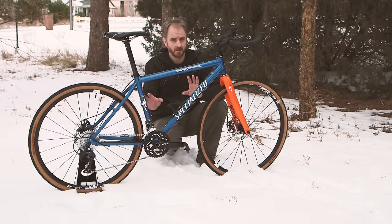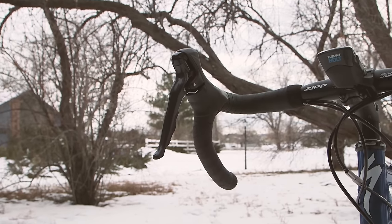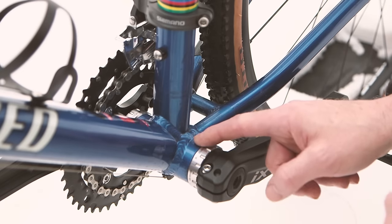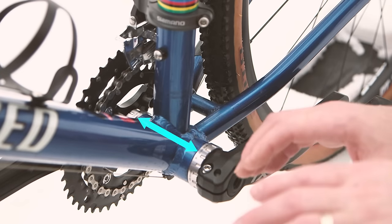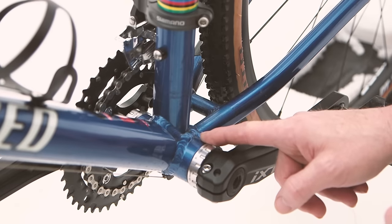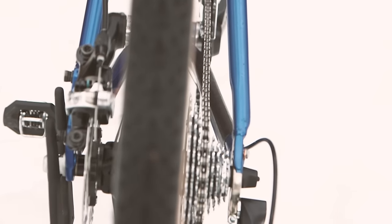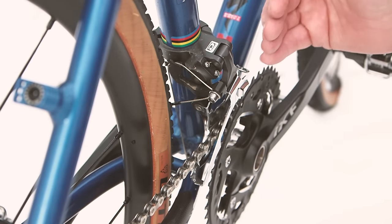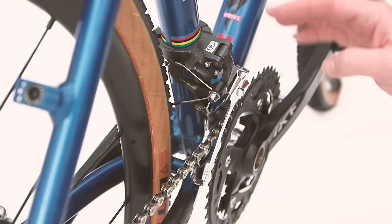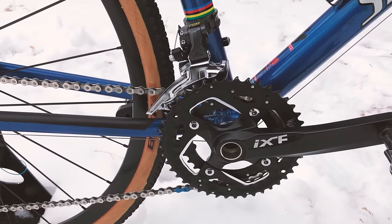The second major consideration is components. A modern gravel bike, by industry definition, has drop bars. Most inexpensive drop bar shifters are designed to work strictly with road components. These old mountain bikes use a 73mm bottom bracket — the road standard is 68mm — so you can't use a road crank set on one of these old mountain bikes; you have to go with a mountain bike crank set. Mountain cranks tend to have a wider Q factor than road cranks, which pushes the chain line further outward. Road front derailleurs don't typically have enough swing to accommodate that further chain line, but mountain front derailleurs do. I'm using a mountain crank with a mountain front derailleur and a mountain bottom bracket.